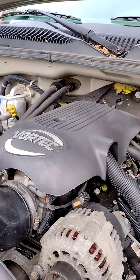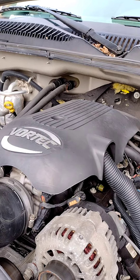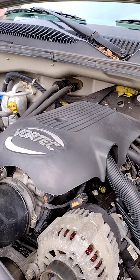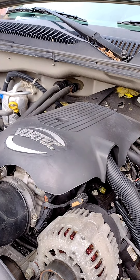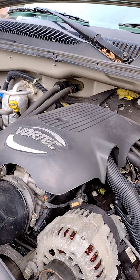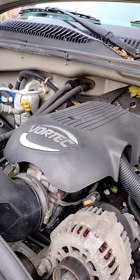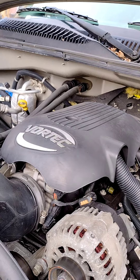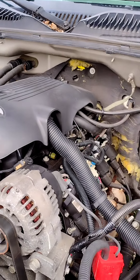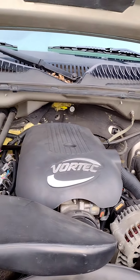The resistance on these sensors is supposed to be around 93k to 107k ohms. I used AC Delco knock sensors and aftermarket knock sensors. I found that when resistance is right in the middle — around 99k ohms — that worked best for me. Those seem to be the best ones, whether aftermarket or AC Delco.